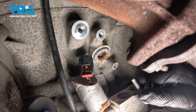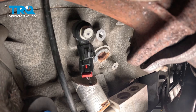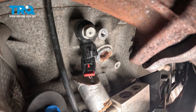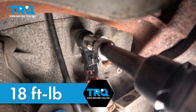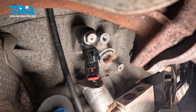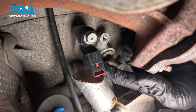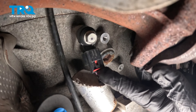Remove the bolt and the knock sensor, then install the bolt and the new knock sensor. Position the sensor in the same orientation it was when you took it out. Snug down the bolt and torque it to 18 foot-pounds — if you can't get a torque wrench on it, do the best you can. Install the connector, push until you hear a click. If you don't hear a click, give it a pull to make sure it's locked on, then close that red locking tab.